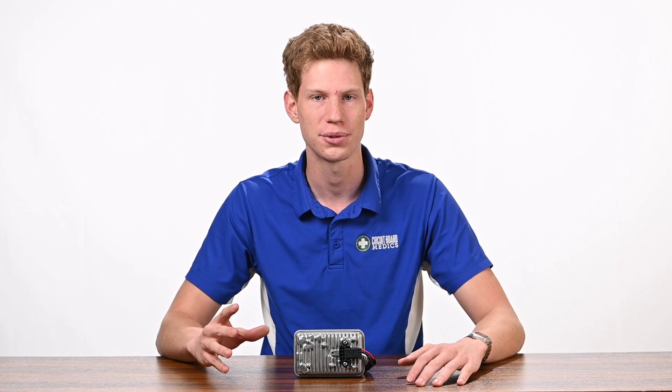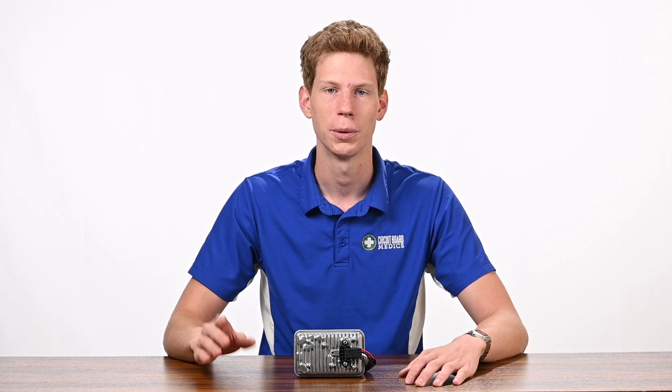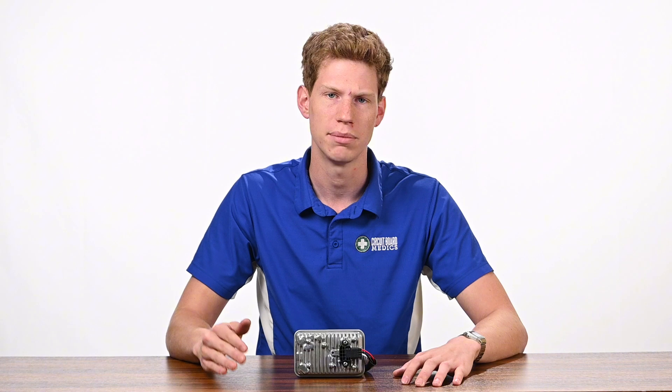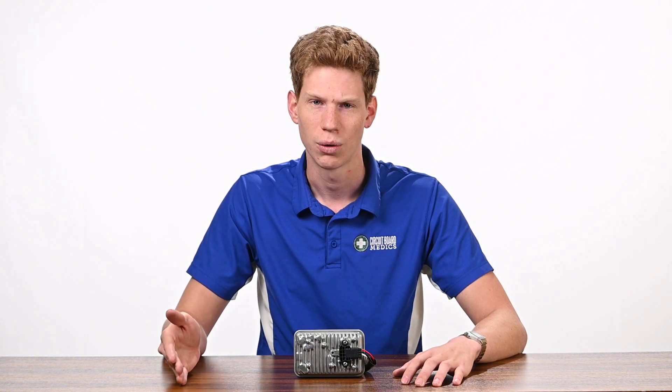This is the turbo actuator used in 2017 to 2023 Chevy and GMC trucks with the 6.6 liter Duramax L5P engine. That engine is equipped with the VGT, or Variable Geometry Turbo. The L5P actuator controls the internal vanes of the turbocharger, adjusting the airflow for faster spool up and minimal turbo lag at low speeds, or reducing back pressure at higher speeds. These adjustments ensure that the engine runs efficiently.